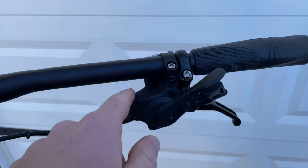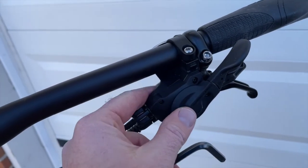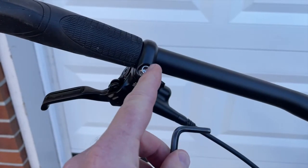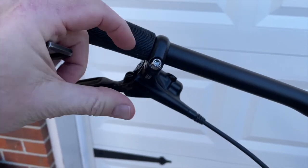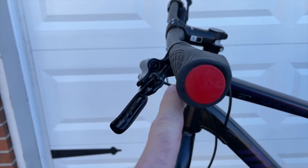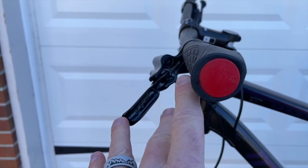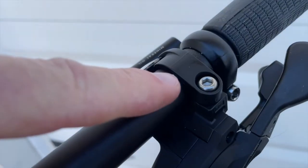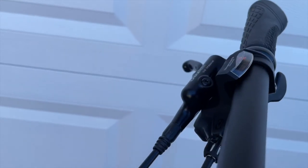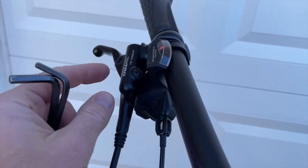Now this is also a perfect time to adjust our brake levers and our shifting levers. We're just gonna loosen this bolt right here and this bolt right here — this is the shifter and this one is for your brake lever. You have another brake lever over on this side. We're gonna need that 5mm Allen key again to loosen these up, and that'll allow us to adjust them so they feel natural and correct for where we're holding our grips. For us the correct comfort angle is gonna be something like this — we'll have to wait till we get out and ride just a bit to feel exactly where these should be. On this side your shifting lever is gonna be a 3mm bolt whereas the brake lever will be a 5mm. Now there are torque specs for this if you're using carbon bars, but for these aluminum bars we're just gonna make sure we use our keys and get them down nice and snug.